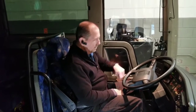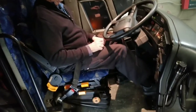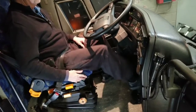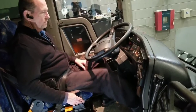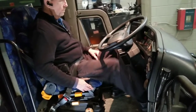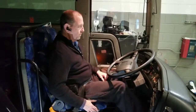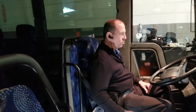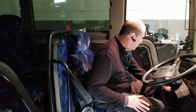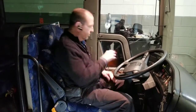The one minute is up, now I'm going to start my pump down. My first light came on at about 80 PSI, and my second light came on at about 75 PSI. My emergency brake popped up a little bit before 20 PSI. Now I'm going to restart my vehicle, and as my air pressure is building up, I'm going to remove my chocks for the last two parts of the brake test.